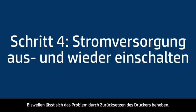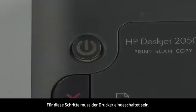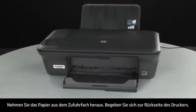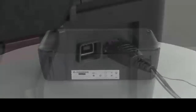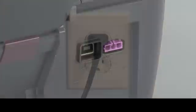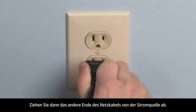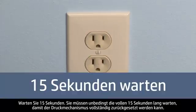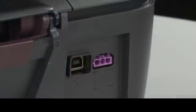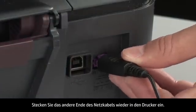Sometimes the issue can be resolved by resetting the printer. The printer must still be on for these steps to work. Remove the paper from the input tray. Turn to the back of the printer. While the printer is still on, disconnect the power cord from the printer. Then disconnect the other end of the power cord from its power source. Wait 15 seconds — it is important to wait the full 15 seconds to allow the print mechanism to reset. Reconnect the power cord into its power source, then reconnect the other end into the printer.